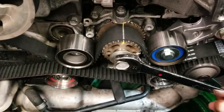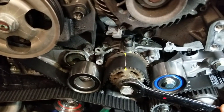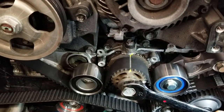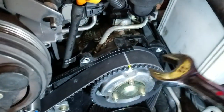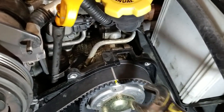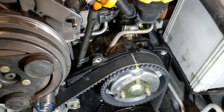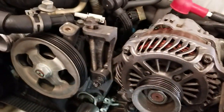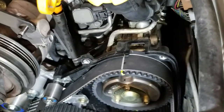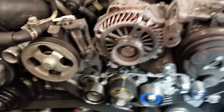When checking, you want to have it turn clockwise and then stop. So if everything looks good except this is off half a tooth, then you're okay. If it's off one tooth, you've got a problem — but half a tooth and slightly to the left on this side is totally fine. If you move it just a little bit, they all seem to match up, just off by about half a tooth. It's kind of annoying for a perfectionist like me, but it is what it is.